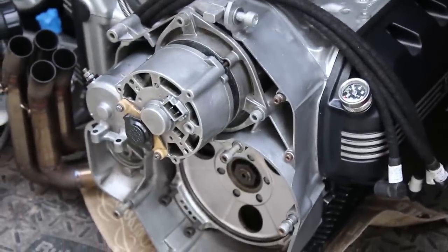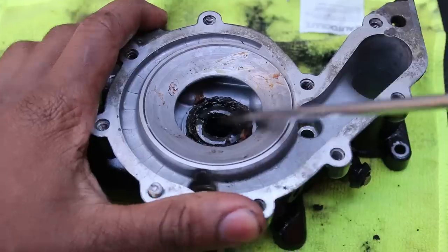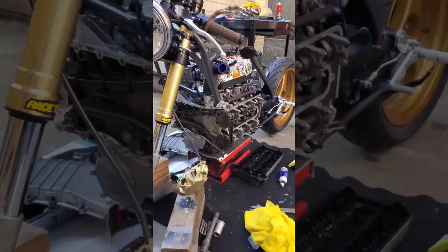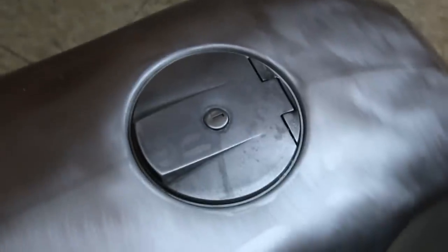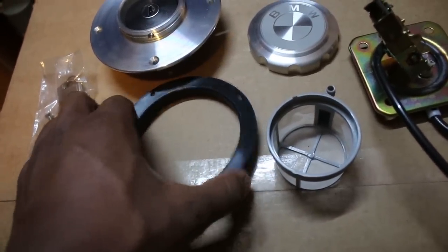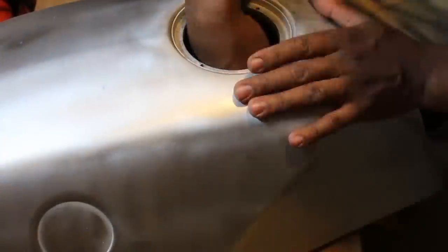So you clean up the bike, you know what you're going to keep, you have a pile of parts to sell — and now it's time to do the maintenance, because your bike was neglected. Expect to do jobs like compression tests, water and oil pump service, oil and cooling changes, spark plug changes, clutch work, rear seal, engine cover seals and gaskets, all the rubber bits around the throttle bodies like the breather, the manifold inlets, and bushings — because those crack and leak, which will make the bike backfire like a pistol. Then you've got all the bits inside the tank: fuel pump, vibration damper, screen, fuel lines, filter, sender — and the fuel stuff outside the tank: more lines, fuel pressure regulator, and the injectors.